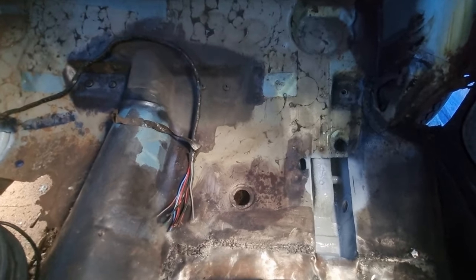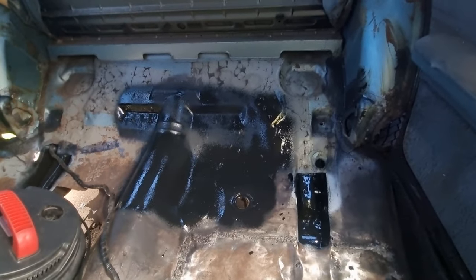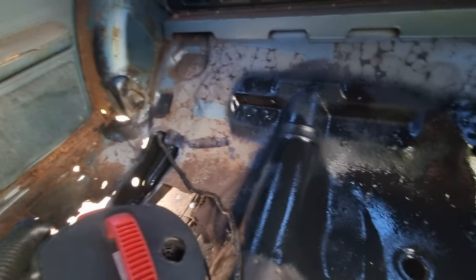So that's what I've done so far, and there it is with all the stone chip in there - brush treatment, primer, stone chip, even in that one. Sprayed it all the way up there as far as I can, even all there sorted, right in them areas. She's getting there, I'm really happy. Once that's dried in the next few days, I'm going to weld that plate back in there - obviously once I've got some bottom wire.